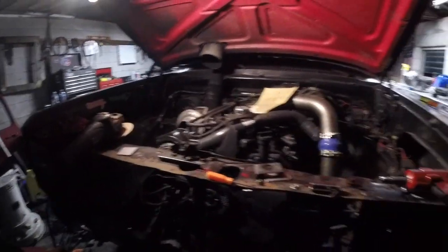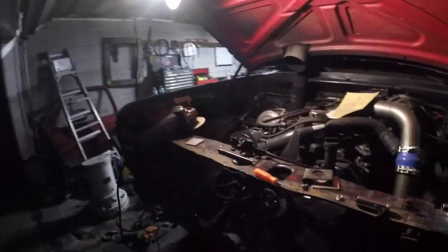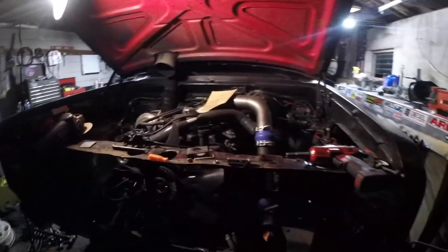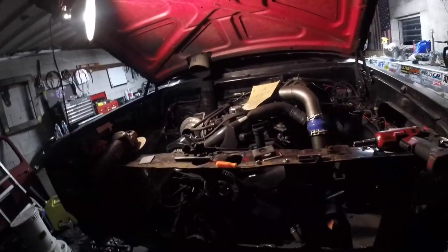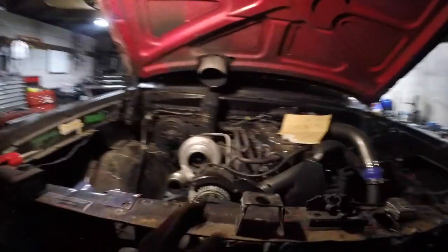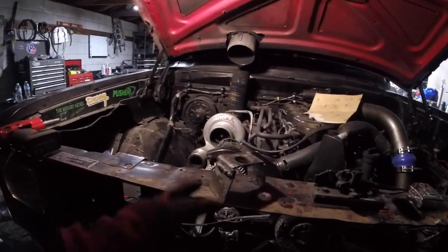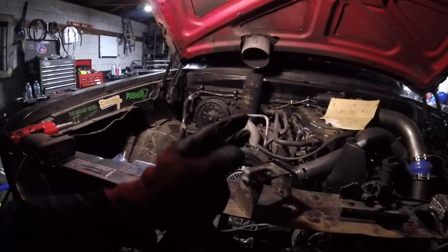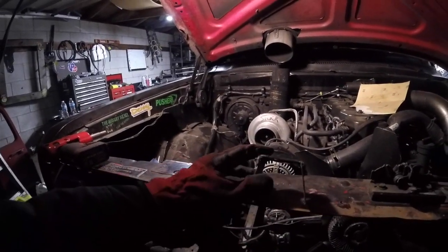We're getting ready to tack this up now after we get the welding wire set up on the welder. After we do that we'll weld these in permanently. It's only eight o'clock and I plan on staying out here pretty late, so we're in good shape. The radiator is a tight fit, but the shroud and coolant bottle do fit, which is good news. After this we just have to figure out the battery situation and the intercooler piping and then we're done with the conversion. For the radiator brackets, I used scrap metal cut to about two and a quarter inches tall, overlapping with the existing bracket about two inches.